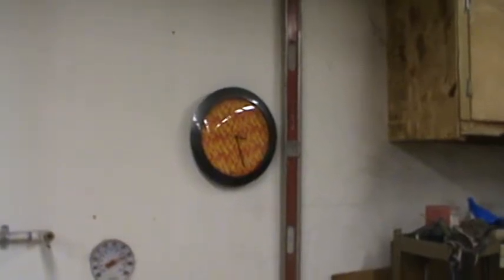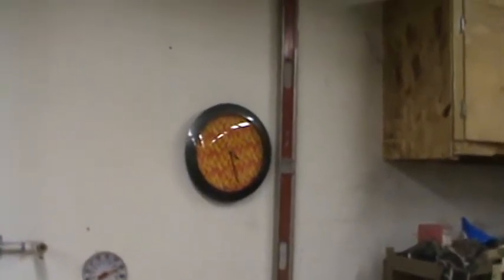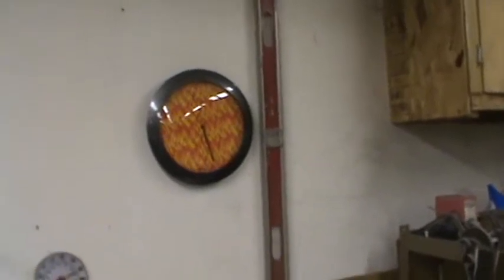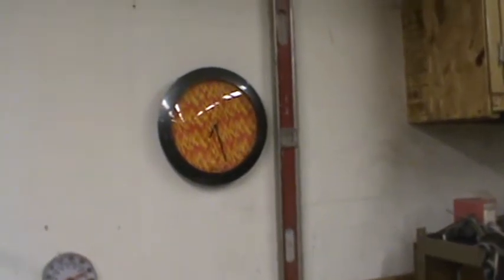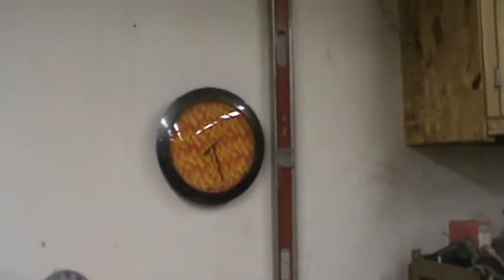But we're getting close now. We still got some spider webs, but we're getting close. Unbelievable the amount of time here. It was about 10 till when I got done with the first coat. And I was thinking, all right, top of the hour, 10 minute flash, that's normally plenty. It's almost as fast as you can get done. Go mix up another batch and start where you started, almost without even pausing. And here we are 35 minutes after we put the last pass on, and yeah, it's still wet. And we're using the fast hardener.